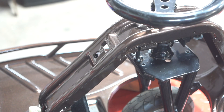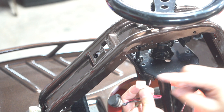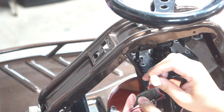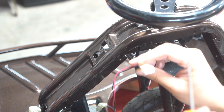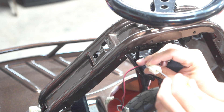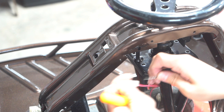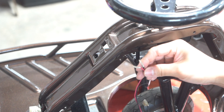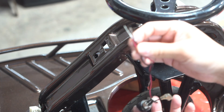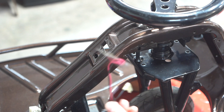With the cart fully disassembled, the first thing you'll want to do is install the new charge port. To remove the old charge port, use the 19 millimeter open end wrench and you'll need to de-pin the stock connector — or you could cut it off. In this case we'll de-pin it: disconnect it from the controller, then from the inside with your pick you'll see two little tabs for the pins. Push those down and you'll be able to pull out the connector.